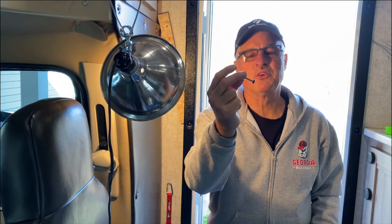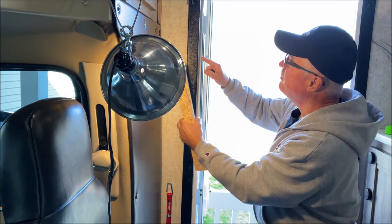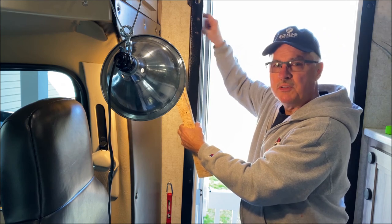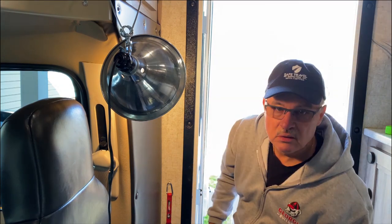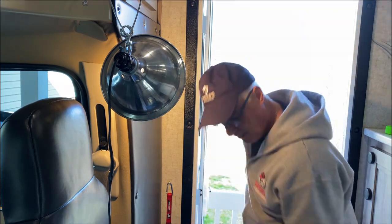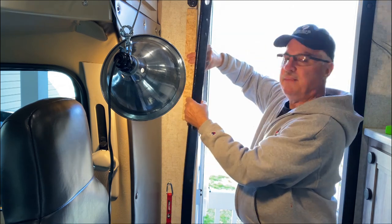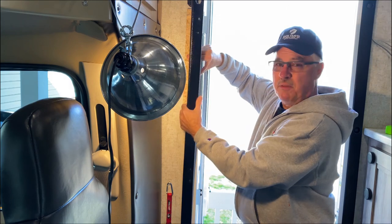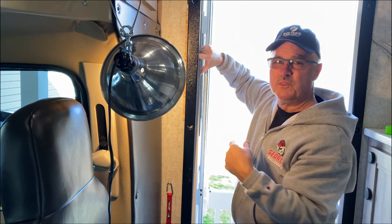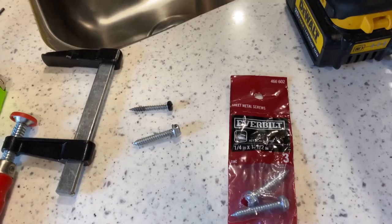As you can see, these are inch-and-a-half screws and they're bent, so they've been under stress for quite some time — in my opinion, they're a little bit too small. What the manufacturer did was put a little furring strip behind this trim piece, then drilled back to catch the door frame, which is an aluminum door frame about an inch wide. The holes in that aluminum have just wallowed out and gotten loose, and that's why these aren't holding. We're going to put in new holes in the frame with bigger screws, and then bond this with construction adhesive directly to here to make it one solid piece. I'll also secure it in a couple of other places with some countersunk screws, then re-drill and re-tap into the aluminum framing and put new screws back in. This should be a quick and easy fix.